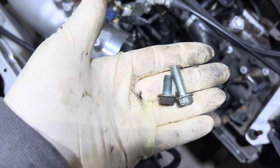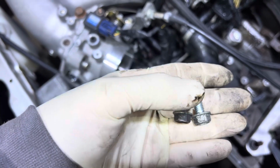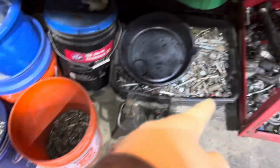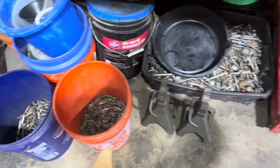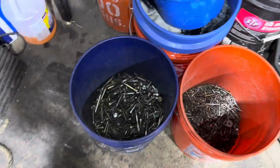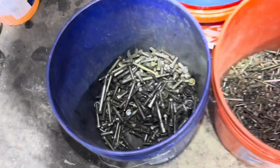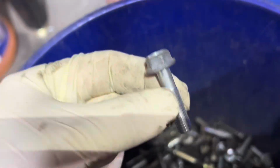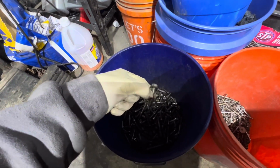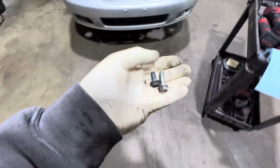So one thing I noticed for the two slave bolts, one's long and one's short. I don't like that. That bothers me. He's going to get the original 2 long bolts. I like to keep OEM hardware. So that's all the 12 mils, that's all the 10 mils, and then in there's all the 14s and 17s. The socket size I'm talking about that fits them. So those would be M6s, those would be M8s. These are all original OEM Honda bolts. So I like to stock and keep all these. Obviously, they're used. Sometimes when the customer's really picky, I'll buy all these new for them. But like I said, it's better than having 2 used wrong length. So you're going to get 2 used of the right length original ones.